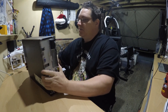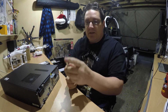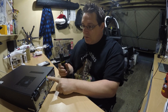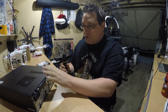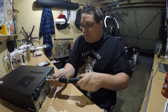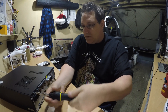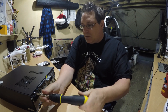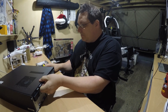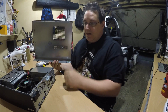So we're going to take a look inside. First of all, make sure it's laid flat down. We've got a screwdriver ready with the right tip bit. On this one we just require a Phillips. We've got two screws here which hold just the top on. So if we just undo those two — nice and simple. Remember to keep your screws in a safe place and remember where all the screws go. Just put on the case now — like so. Comes off nicely and lifts off as simple and easy as that.